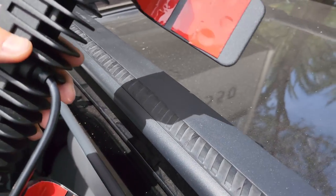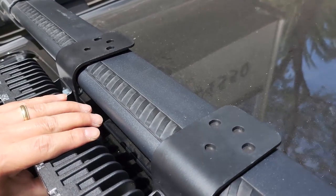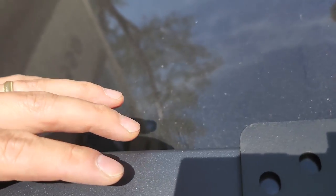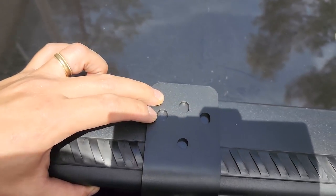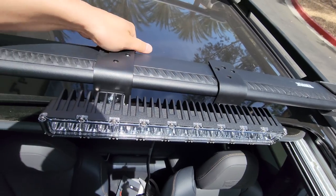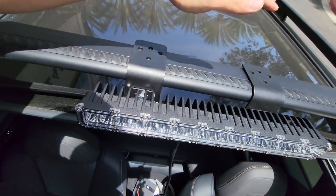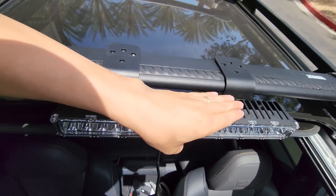What I'm attempting to do is put more double-sided tape — 3M outdoor double-sided tape. It should hold because my roof box actually sits on top of this and it should hold. Worst case, if it doesn't hold, I'll just drill some holes and tap and screw the hell out of this. It's on there. I guess I have more faith in double-sided tape than some of you do. It's actually moving the whole car. With the weight of the roof box, this should hold in place.